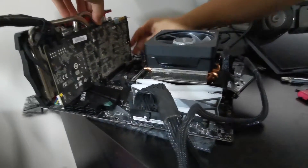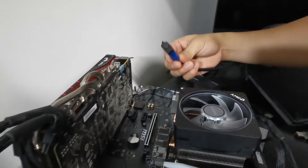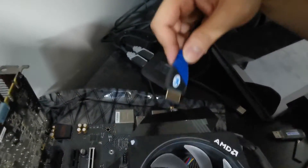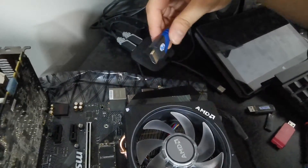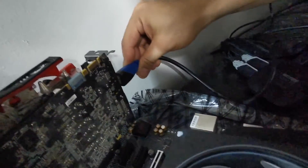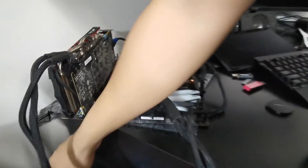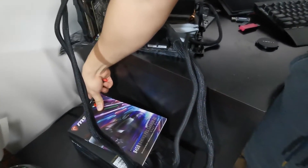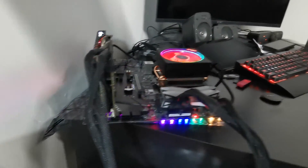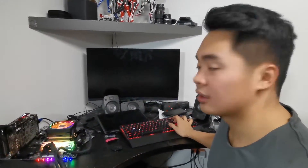Make sure you get that click going. As you guys can see, you gotta take this one out from here because the CPU doesn't have integrated graphics. So you gotta put this back here and turn the power on. I'm going to short the power jumpers — I was going to press Delete to hop into the BIOS.